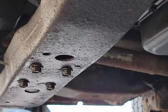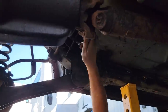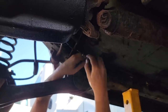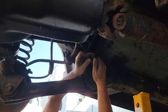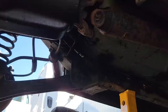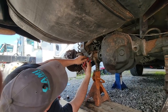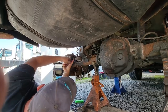We're going to take that loose and cap it off. I'm going to take this line loose - I don't want to lose all my fluid. What I do is take caps off gear lube bottles - they've got little rib serrations in them. Put that over top of there and give it a push, and it'll lock in place and stop leaking. You can see how it bulged out the plastic. Now we can go ahead and take the rest of this apart. I'm not going to bother trying to get these lines out - I'm just going to replace the ends. I'll cut the brake lines so I'll have something to use as a template when I make the new ones.